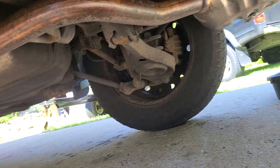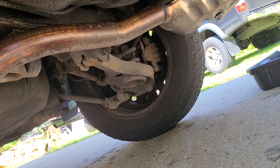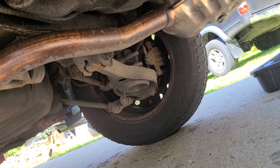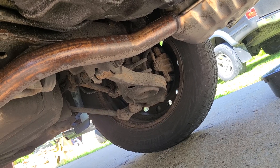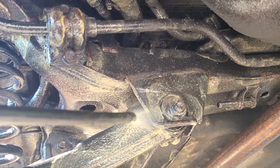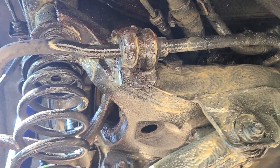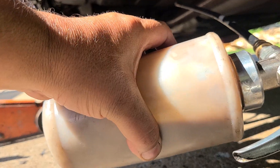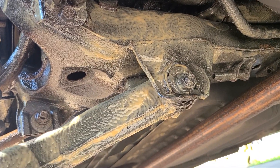As you can see, the other side has been fluid filmed but it's not wet. Right now we're going to throw more on there. You get just a slight little bit of surface rust speckling, but it doesn't rot the structures out. We're going to go ahead and coat them, get all these good. I'll give you some live action here — you can see how it goes on, it goes on really nice. Now, this is my daughter's car, so we're going to coat this thing up. Normally it takes two of these jugs to do a car, but we're going to put copious amounts of it on — probably two, maybe three of these, because at the end of the day, I've got to be the one that works on this car. So I want to make sure all the hardware comes off.